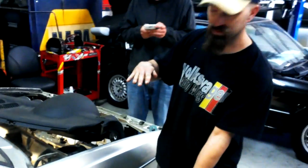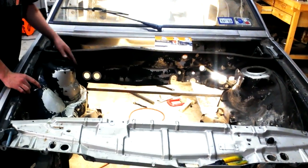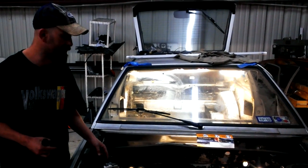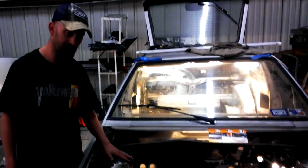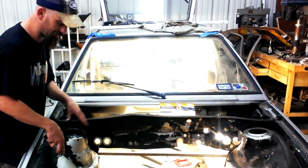The only real problem we had was that from strut tower to cradle was about 2.5 inches taller than what the hood would allow in the vehicle, so it would make the car sit all tall. So what we're actually going to be doing is cutting out the hats. We'll be squaring them off here. Once the cradle's in position, we have another TT here, and we're going to make jigs and jig the hats on the other TT, so when we come to this vehicle, we can make hats from scratch and already have jigs in place to make everything weld up.